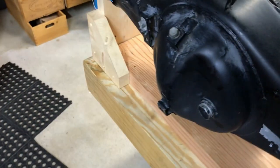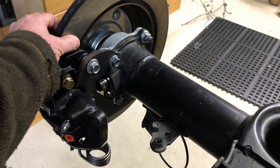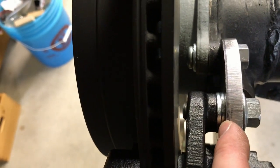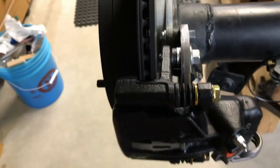I needed it to make sure the axles were centered, because it's key when you need the axle to be in the spot where it's going to be. When you compress the caliper it's going to tell you where it wants to be in relation to the bracket you're going to make. You can see right now we're grinding just a little bit on this side. It turns out that two washers are almost perfect — about one and a half washers would be perfect. So the last thing I really have to do to get the spacing correct on both brackets is to probably just grind down one of the washers about half height. I'm going to JB weld them on here, then wire brush them and put a coat of rattle can on to protect them so they don't get rusty.